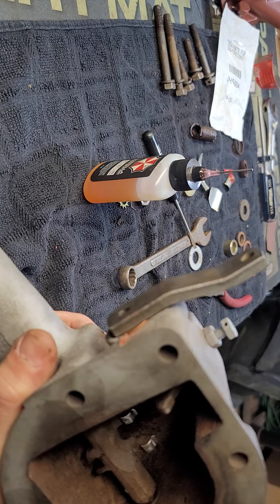I'd only had the tractor running briefly once the engine was rebuilt — it did start up and run fine, didn't surge. But since I already had the tractor broken down to this level, I figured I'd fix the governor while it's easy to get to. I'm glad I did, because the star washer underneath the nut had literally broken into sections inside the governor. On top of that, the spring was bent and weaker than the new one. All these little fixes will save issues in the future.